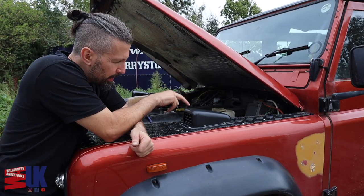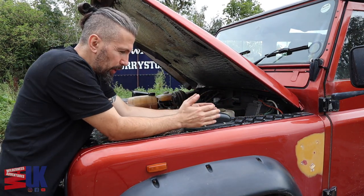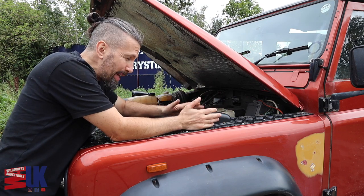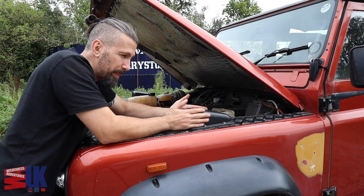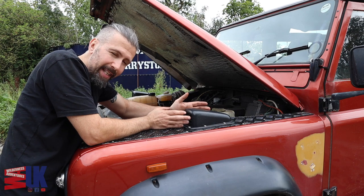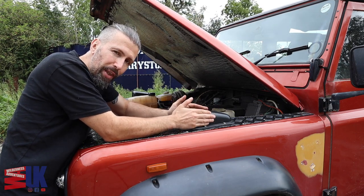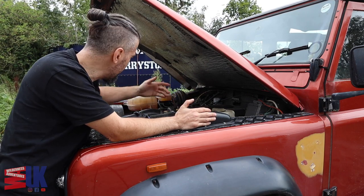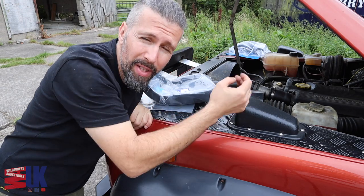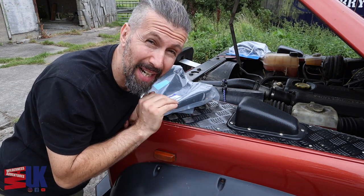So these things just here - this is an air vent and its purpose is to suck air in through to your heater box to blow air into the vehicle. On a normal Land Rover it's just a flat grate and when it rains, the rain gets into the heater box sucking water into your fan motor and rusting your fan. These aftermarket raised ones with the hole on the front make it more difficult for rain to get in. The ones I prefer come around the wing - I had them on my 90 and I'm going to put them on this as well. In theory you only need one on this side in the UK because this is where your heater box and heater intake is, but I like things looking symmetrical so I tend to put them on both sides. Dare I say really really easy to do - seven screws, Phillips heads, whizz them out, gasket on, new snow cowl on, job done.